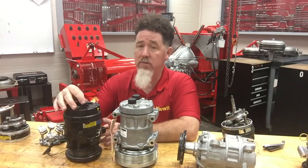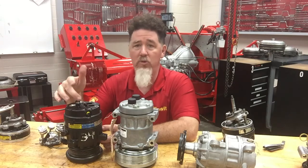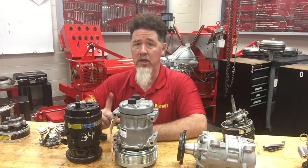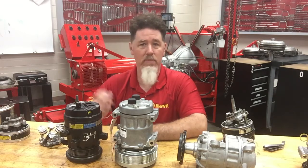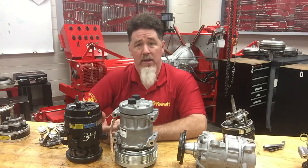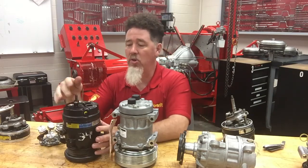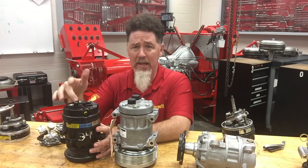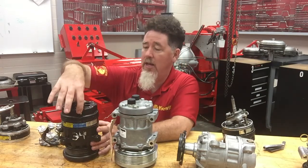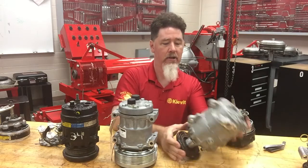This component right here on this compressor is the blow-off valve. If pressure gets to, say, 500 pounds and the system does not kick off, refrigerant will exit out of there. I've seen that with bad pressure transducers — they turn the fan on and kick the system off when pressure gets too high, but if they're reading 70 psi all the time, pressure builds and builds, the fans never kick on, and eventually all the refrigerant comes out of that blow-off valve. The key is I want to make sure I'm not just looking at a high pressure cutoff switch. What I see here is a bore with a valve in it — so this would be an example of a variable displacement single acting coaxial compressor.